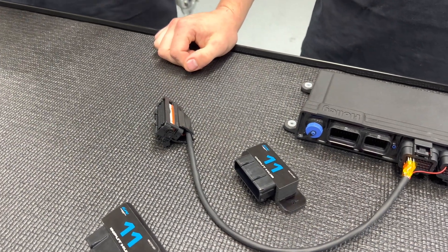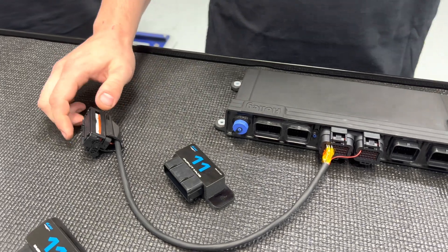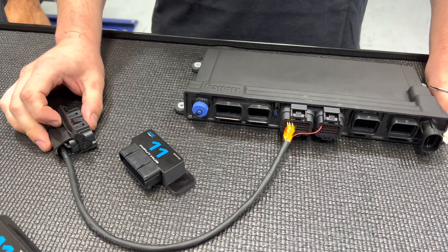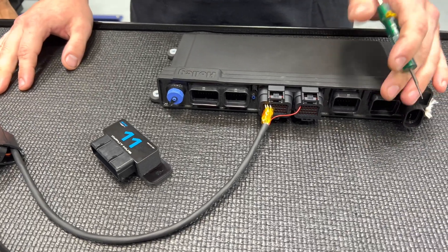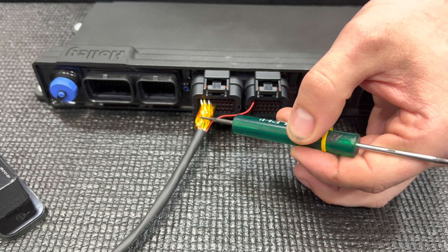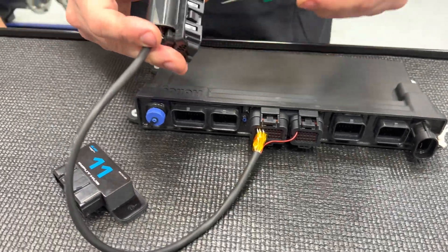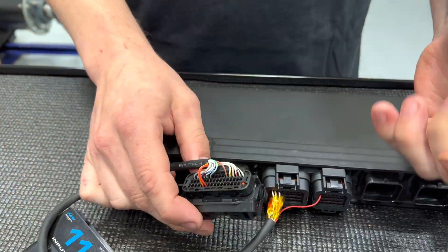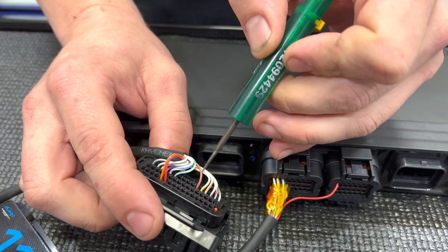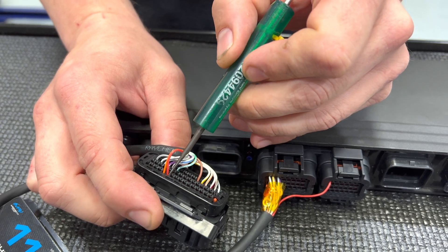Here we are on the bench. I wanted to get Mitch to give us a good visual explanation of the proper way to wire this thing up. I've got a customer's harness here that we built for him — he wanted it to be as easy and as quick as possible to add his sensors. I populated the J3A and B connectors with the 11 inputs, a zero and a five volt, and he's wanting to pull a 12 volt from the B connector over here. Then I ran all the inputs down into the input hub connector — all these white striped wires. The zero volt or sensor ground goes to one, the five volt goes here, and the 12 volt from the output goes right here.